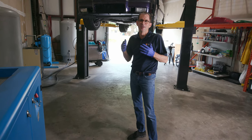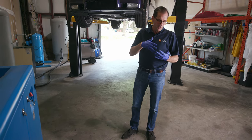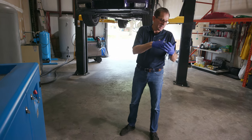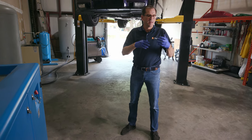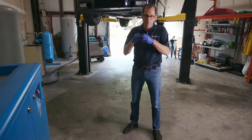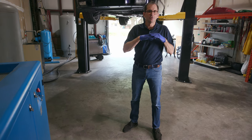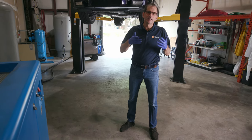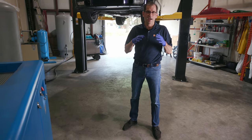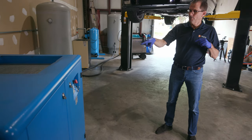That's what everybody wants to know, because it's a process that we'll get over when I get to the material. You'll see the dry ice sublimates to a gas. It's basically when you're propelling it and it's hitting a substrate or surface, that dry ice is converting from a solid form of CO2 to a gas form of CO2. So even though the word ice is in the name, there's no moisture, there's no water. The only water issue we have is potentially right there in these crazy compressors.